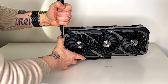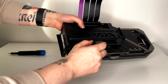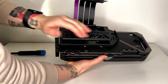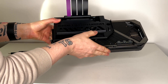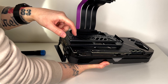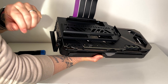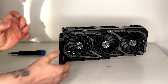Here we've got our GPU firmly fixed. One thing I liked is that even though it's near this part, you can see all these holes allowing airflow. When the GPU gets hotter, you have all this area for airflow so you won't be stuck with hot air on the GPU. As you might know, this is a 3090 with 24GB of memory — some memory modules are on the back and get really hot. This improved airflow design is going to help a lot.